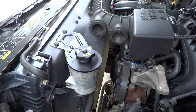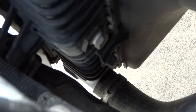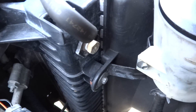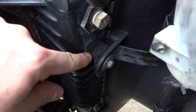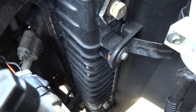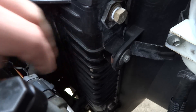The first places you're going to want to check are right off the radiator. We got the inlet right here at the bottom where the water pump pulls it — you're going to want to check that. Run your finger around it, see if there's any kind of antifreeze. Also check the radiator itself. I noticed on mine there's a little crack starting on the mounting bracket, but it's actually not leaking at all, so it's not a problem right now. I'm probably going to hit it with some epoxy so it doesn't crack anymore.